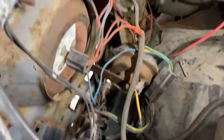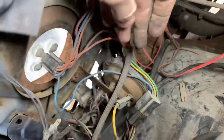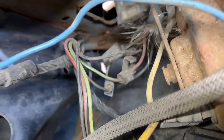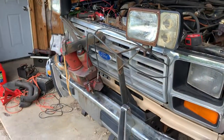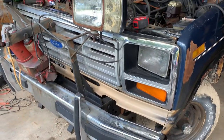How they wire in plows - this is actually the plow harness and then it tees off. They used to be blue connectors but they're kind of nasty. They're called vampire connectors - they just splice into the line and eventually cause issues. So we're going to pull the headlights out, remove the wiring for that, run new headlight wiring. We're just going to run aftermarket light pods on the top. You can see I've got turn signals on the side of my fender and in the front - all my turn signals do work.